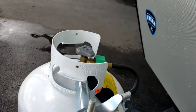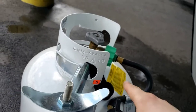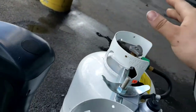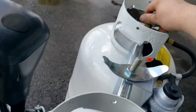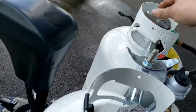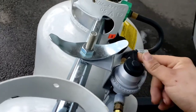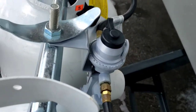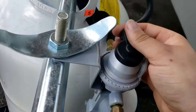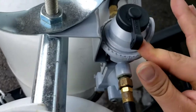Dual 30-pound cylinders — they are filled, so you don't have to worry about getting them filled. There's an automatic changeover regulator pointing to one tank, so it will pull from that tank first. Once that tank is empty, a little diaphragm will open up and it will automatically switch to the second tank. There is no real way to know it has switched without coming out here and physically checking. Some people put the regulator in the middle thinking it'll pull from both tanks equally — it doesn't work that way. It's one or the other, never both.